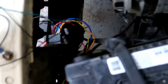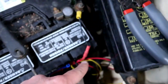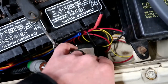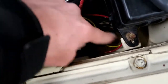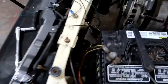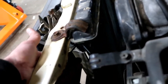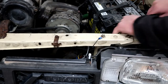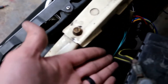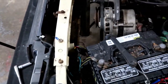Okay, so we got these wires all nice and tucked. This main harness kind of comes together, all stays close and tight up underneath here. We've got a couple loops here, and then we've plugged into the battery and plugged in the other end on the orange where my terminal was. That black wire is going back to the fan, and the yellow is going in on our side of the fuse box. Now I've just got to tidy up the green wire and the black ground wire — we'll loop those up a few times. Also ran the gray wire up underneath here over to the thermostat. Zip tied it to the negative wire, and the others are zip tied down there, so all tucked up. We can start it up, let it idle, and see if that fan kicks on.